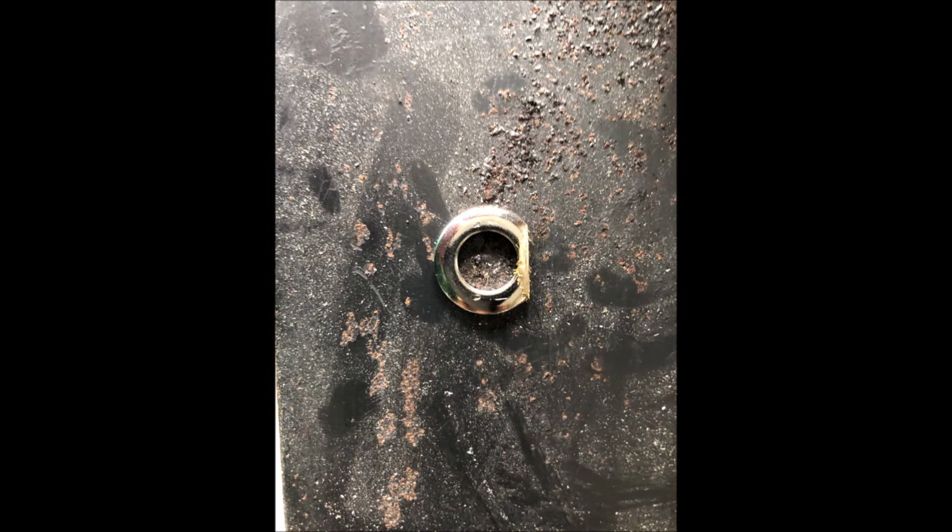Here's the tricky part of the job, at least in my case. Because the rim of my tire's geometry sloped up around the stem without allowing much clearance, my stock washer didn't fit. So we had to trim part of the washer like you see here in this picture. Then it fit no problem, and I tightened the nut on top of it with an open wrench.